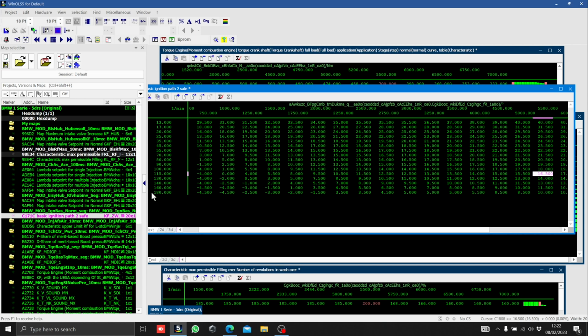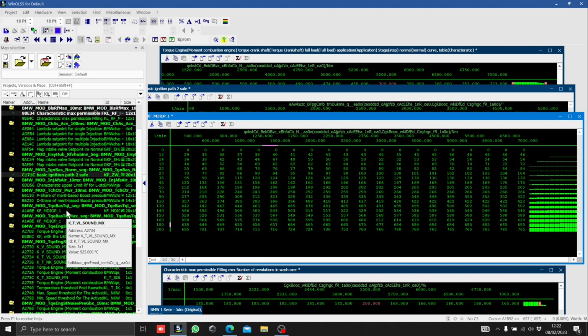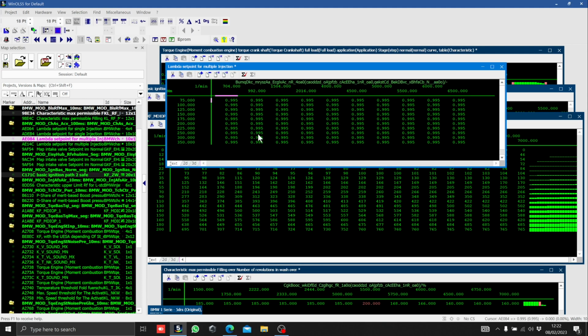It's also important to recalibrate this if you are putting more load in. So for example, these numbers can actually go really high. You can recalibrate the ECU for more load, you can calibrate the ECU for more torque, for example, set all these numbers higher, and then the good thing about doing it that way is the gearbox will see the correct values. So instead of just changing one, not the other, you want to do them both together. So looking at that, that explains how the ignition timing is working.